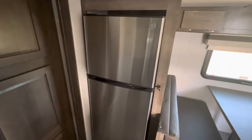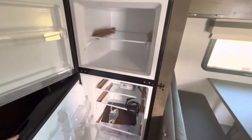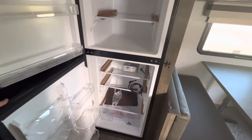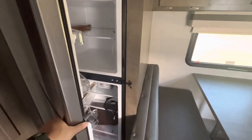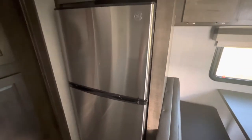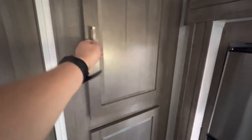When you jump up to the Mini-Lite, so if you're familiar with the GeoPros, you get a larger fridge when you move into the Mini-Lite series. They are still a 12-volt fridge, so they take advantage of the solar on top. You don't have all of the inconveniences that come with propane-based refrigerators that have to be 100% level to work efficiently, and they also struggle with high elevation. With a 12-volt fridge, you don't have to worry about any of that. They actually cool down a lot faster too — so if you're prepping for the weekend, plug it in and she'll cool down awfully quick. There's also more storage to the side, so plenty of storage in this unit.